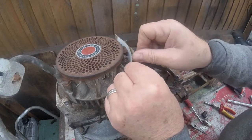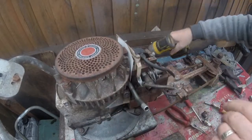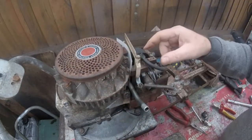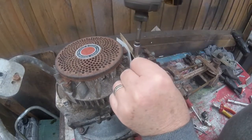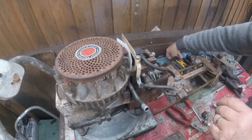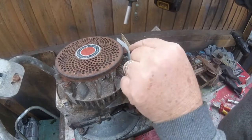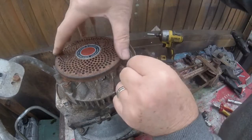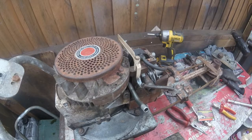So all I'll do is I set that up like that. Unscrew those. And then as you saw, that locks into there, and that's going to be my gap for it. So then all I'll do is just give that a little lock up there, and the same as this on that side. And that should be alright, and then we just take that off. Now we've put the spark plug back on and then we should have a spark.